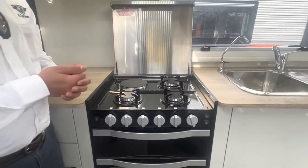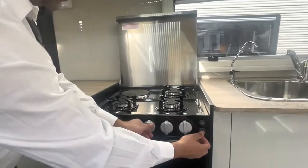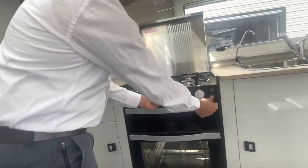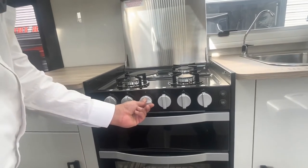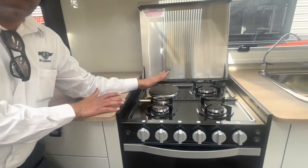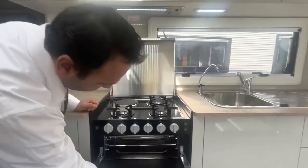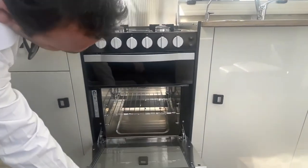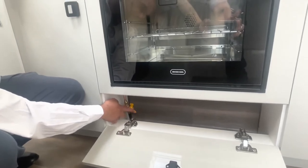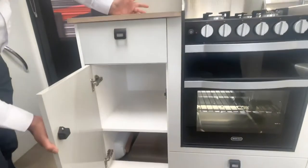You've also got a cooker — open it up nice and easy once the gas is turned on. There's a light for the oven and a little ignition. Push, turn, and you'll see the gas ignite. Hold the burner for a few seconds to allow smooth gas flow, then release. Same principle applies for the 240V cooktop — very important: make sure the 240V cooktop is cooled down completely before you close the lid. There's a safety mechanism for that. There's also a little yellow valve underneath — that's the isolation valve for the gas. If you're not using the gas for a long time, turn it off, and always turn the gas bottle valve off as well.